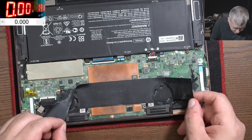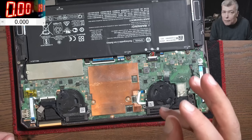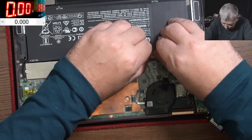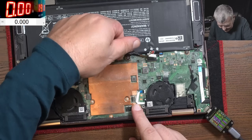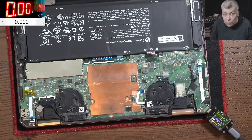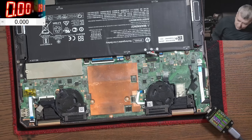What I'm curious about is who is taking 800 milliamps. I'll plug the charger and disconnect the battery. The 800 milliamps is not being taken by the battery - something on this motherboard is taking 800 milliamps and you have to find out what it is, because there is your problem. It's not the motherboard being on - you'd see fans spinning.